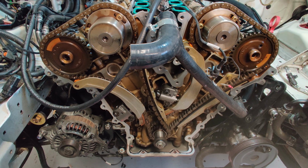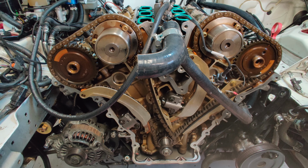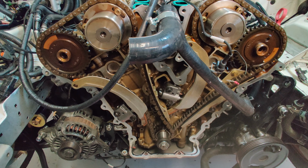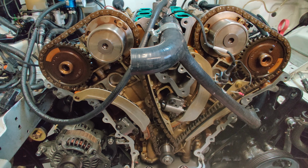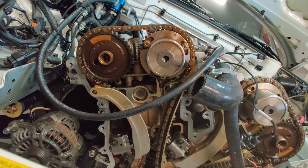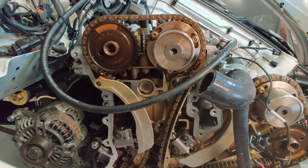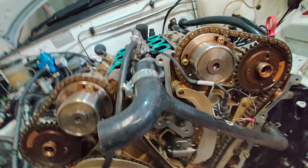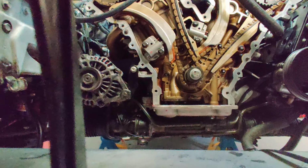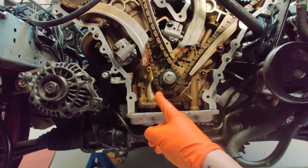After rotating this again, I can't seem to match up those values of 7 o'clock, 1 o'clock and 8 o'clock. I finally figured it out. Basically, you have to follow the orientation of the engine and think about each bank like that. They call this the right bank because it's as if you're sitting in the driver's seat. And this bank like this. So the keyway down here is at 7 o'clock. I don't know if you can see that. It's in here.